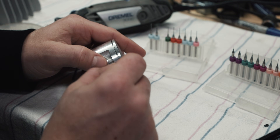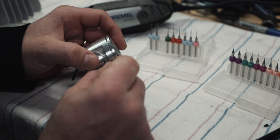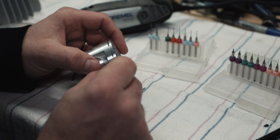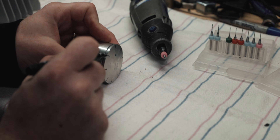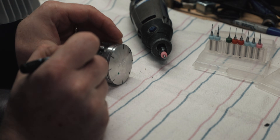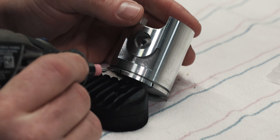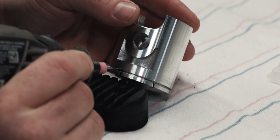It's really important that you do not hit the lower landing or you'll get blow-by. You only want to hit the top. Transfer the marks to the side so you know where you're going to Dremel. Now we're going to plunge in all the way to the end of the ring land and make sure not to hit the bottom.